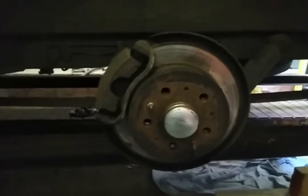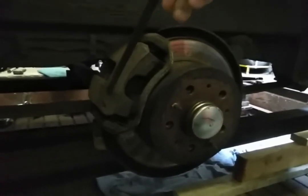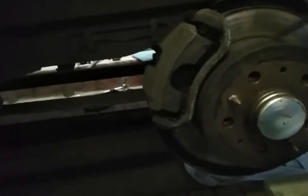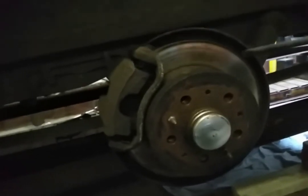When you've got your wheel off, this is what you'll see if you've got a Citroen Relay. They are disc brakes — the foot brake is disc brakes. The foot brake caliper is this bit here, and you've got your pads inside. The handbrake on this particular model — because there is another design where the handbrake is incorporated in the caliper — on this one you've got little handbrake shoes inside here. So this part of the disc acts like a conventional drum brake, and the little handbrake shoes are inside there.